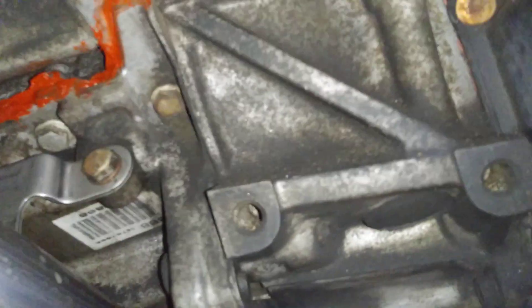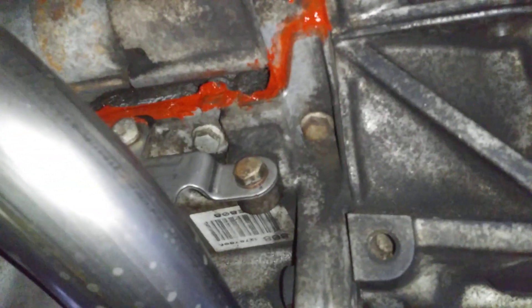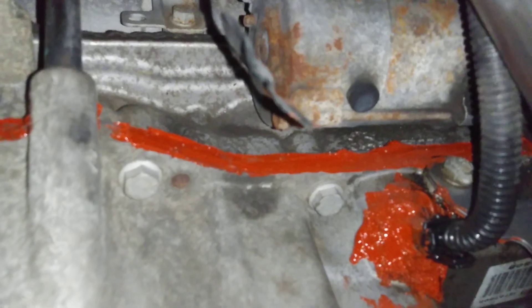So what I did — I wanted to share the process. I used brake cleaner to de-grease the areas where you can see the red line where the oil pan gasket mates against the bottom of the engine and against the transmission. Then I used a wire brush wheel to clean as much debris as I could, and then I cleaned it again with a degreaser.